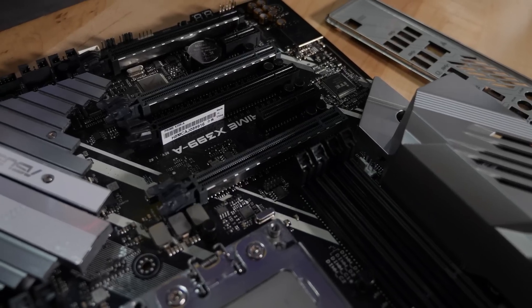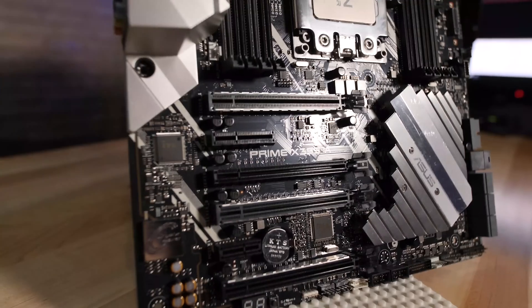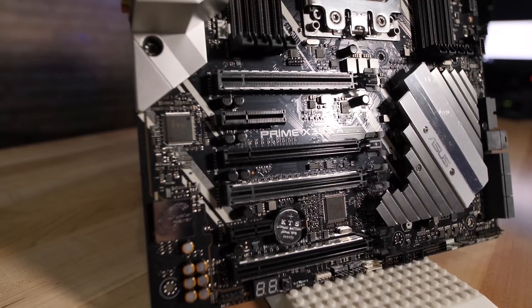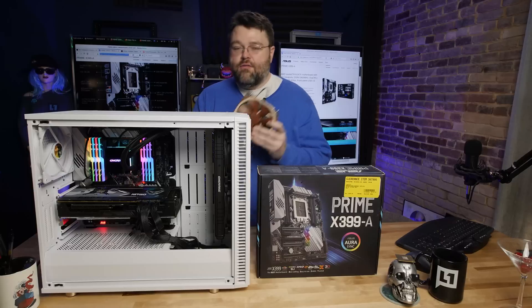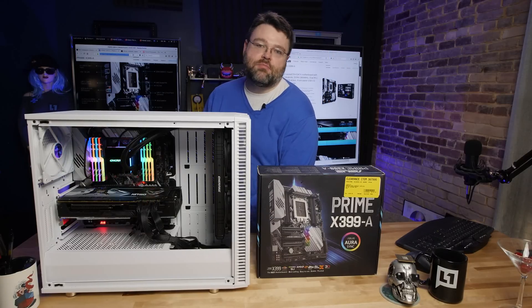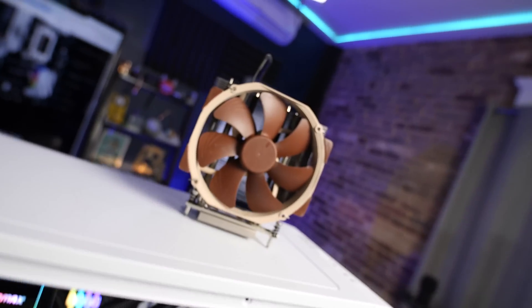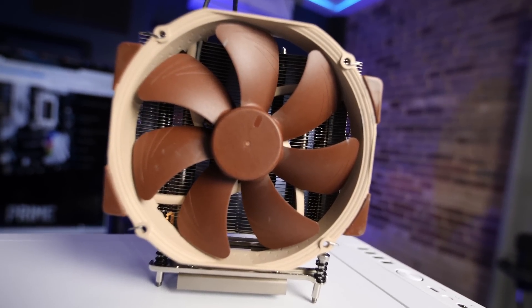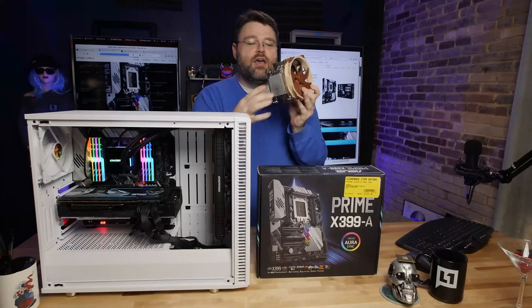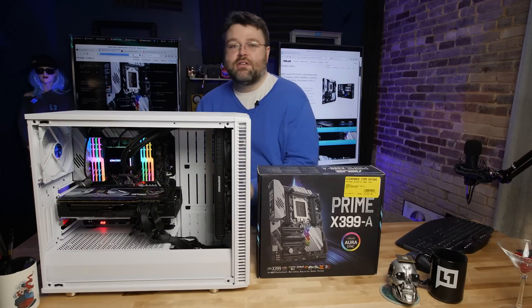As it is now, you'll have to move your graphics card from the top slot to one of the lower slots to make that work. The board layout is also offset by one slot, so the first slot is unused to give you more breathing room around the RAM and CPU. If you're running a really tall cooler like this, there's no danger of it interfering with your first PCI Express x16 slot. Some Threadripper motherboards really pack in the PCIe connectivity, so if you run a tower cooler and the first slot is not offset, the graphics card could end up directly under or even touching the heatsink. Noctua heatsinks do have a little offset adjustment — you can unscrew them and offset a couple of millimeters if clearance is tight.